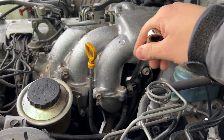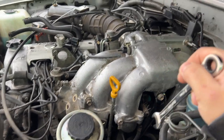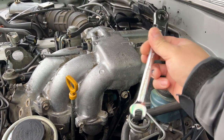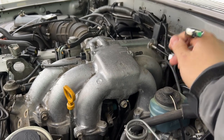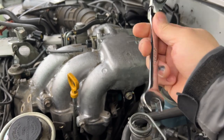We're not going to do the fuel filter or anything like that, because this is the Lexus — this is just my beater. So that's the tip for you guys: you might be able to get the EGR pipe with the 12mm flex head. What happened was there are two bolts on the pipe — I was able to get the bottom bolt but then the top one is so hard to get a socket or wrench on it.